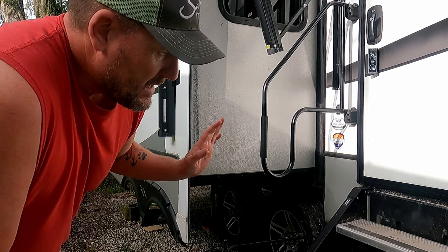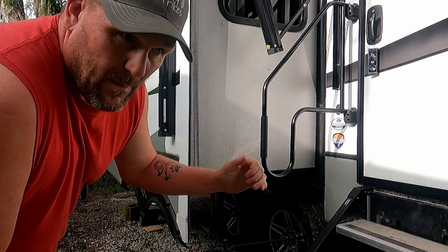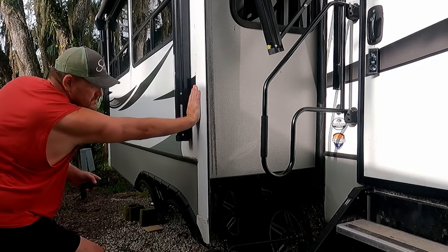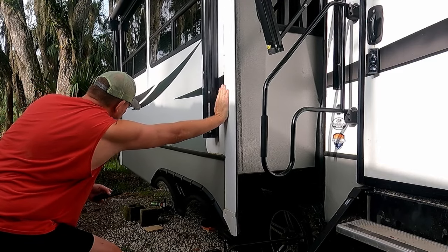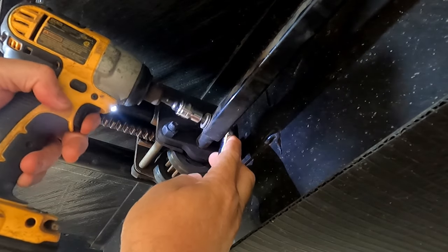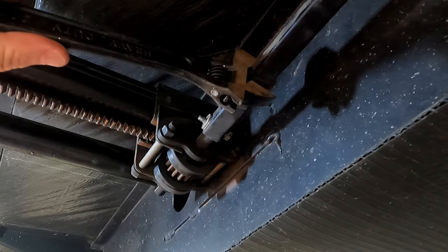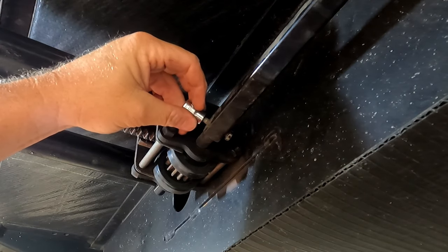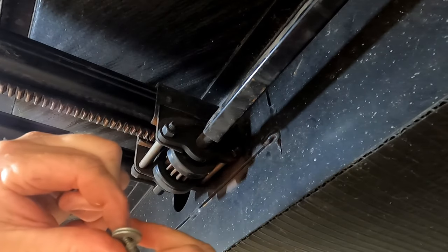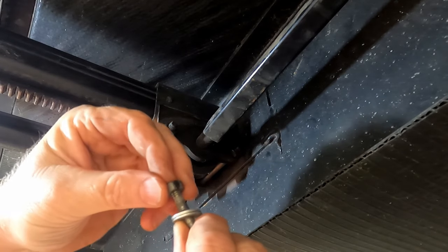They say the first thing to do when replacing the gear pack is make sure the slide is about halfway in because you have to jack it up a little bit. If it's halfway in it creates a pivot point so you can take the pressure off the gears. As you can see there's way too much play in that gear — hopefully this will take care of it. First thing that comes off is this bolt right here, which alleviates the tension. Put the nut right back on the tip of it, tap it a little bit, then take that nut off so you can pull it out. Good idea to put everything back together out there so you don't lose pieces and parts.